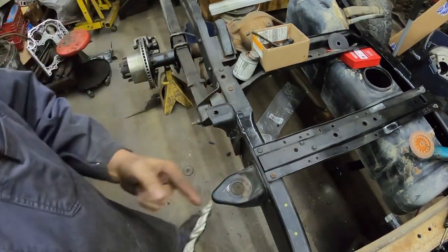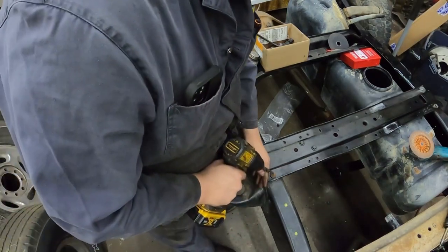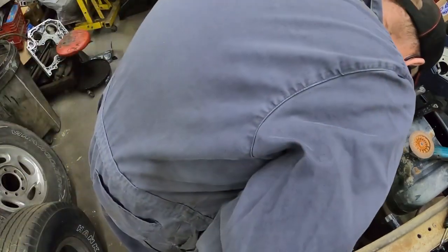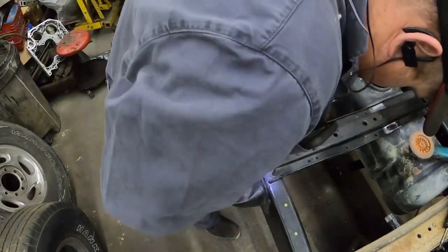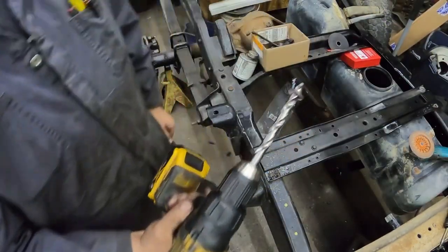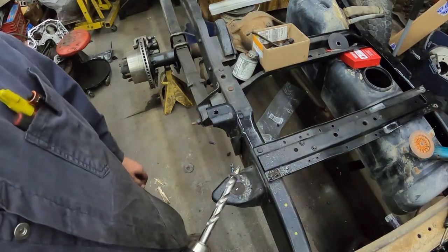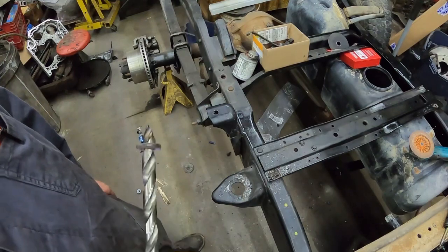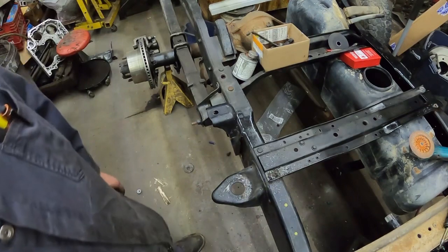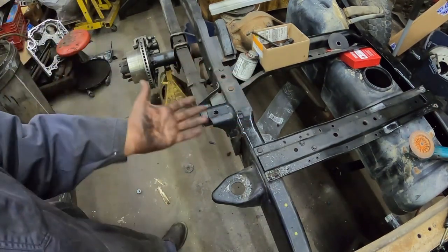You can do it with a smaller drill bit. This is the right size drill bit for doing this hole. You need to get in the middle of it, or as close as you can. And then the head comes off, just like drilling a regular rivet, right? I probably should have been using a little bit of coolant or lube. But anyways, that is three ways to do it.